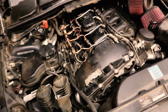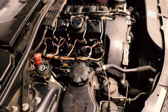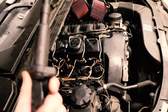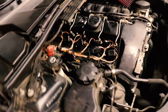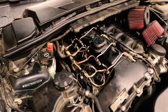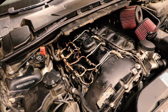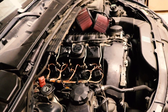Well guys, this video kind of went from a troubleshooting video to 'but wait, there's more.' I thought for sure I was just going to need to replace a coil pack, maybe the spark plugs. It's always a good idea — if one spark plug goes, replace all of them while you're there; if one coil pack goes, replace it. But I ended up needing a new valve cover gasket, because that's what having that much oil on top of the cylinder head and on top of the spark plug means. The next video will be me replacing the valve cover gasket.